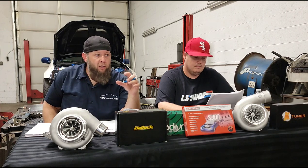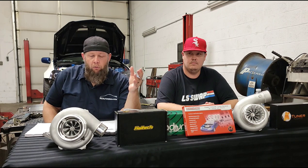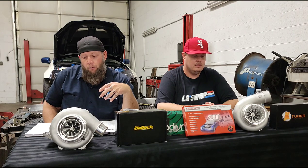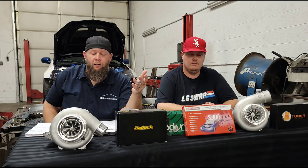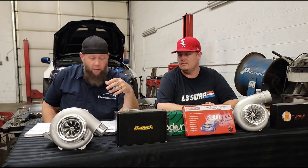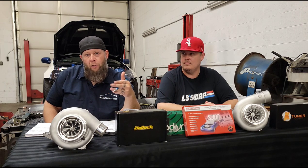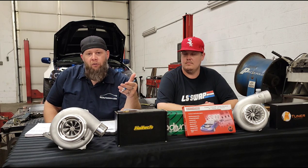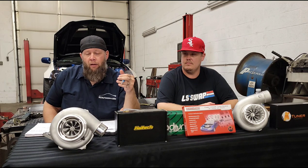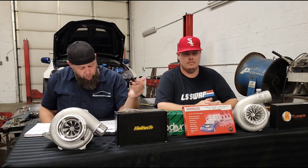Moving into fuel and fuel pressure — the checklist recommends a fuel gauge for every application. It's a liquid-filled fuel gauge, about $15-25, available almost anywhere. For newer cars — roughly 2008 and up, fairly stock — you don't necessarily need one. But for bigger builds, a 95 Civic, or a 94 Camaro, it's nice to have to confirm proper fuel pressure. We had a guy not long ago whose brand-new no-name fuel pump just died — having a gauge made it much easier to diagnose.